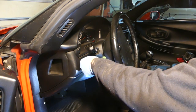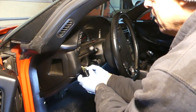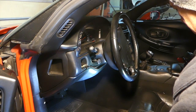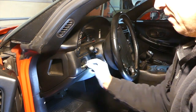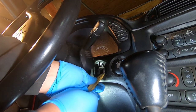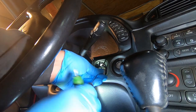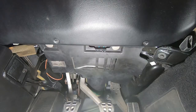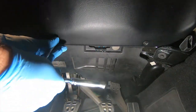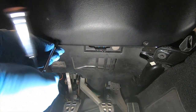Now we're going to take that hazard switch out. Pop out the catch release and fog light switch. There's a T15 screw in there, and on the other side there's that little vent with the sensor — take out another T15 screw. There are two more screws underneath; these are both seven-millimeter screws, at least on mine — some people have Torx screws in theirs.